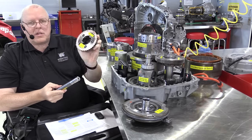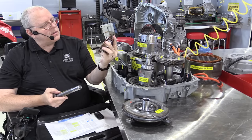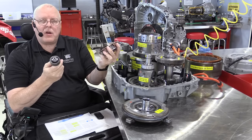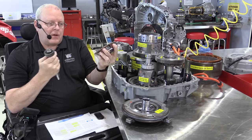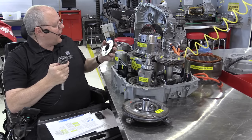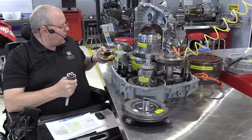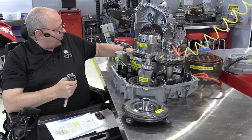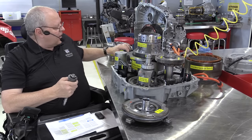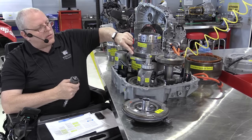All right, here's our planet carrier. It has 37 teeth on the sun gear and 73 teeth on the ring gear. The number of teeth on the planet gears don't matter at all. This is a 5-pinion planet carrier, so it's meant to transfer a pretty decent amount of torque. Once again, if this carrier rotates, it connects through the shell to the transfer drive gear to make